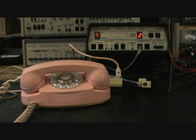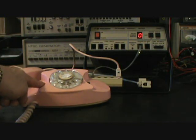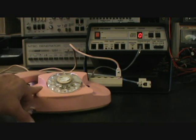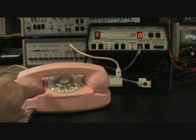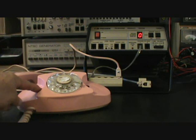I have the light set up — there's a switch in the back — so that when you pick the telephone up the night light goes on. You'll see it come on and go off as I press the hook switch. The other option is to reach around and turn the switch the other direction. Basically when you hang up the light goes dim but doesn't go off, and then when you pick it up it gets bright again. That was so that you could see the phone at night, and when you picked up the handset you could see the brighter light and be able to dial. The light is on right now a little bit in dim mode, and then it comes on bright. I'm going to flip the switch back so that it goes out when you hang it up.